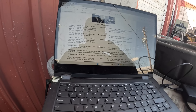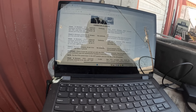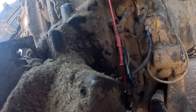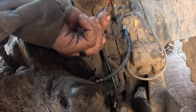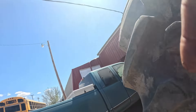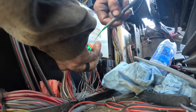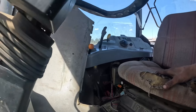Check between PTO solenoid connector terminal B, harness side, the brown wire, and pin 5 on J2 connector. Now I want to go to pin 5 — the brown wire — and then to the next wire over on this connector. 0.5 ohms — nothing wrong with that.